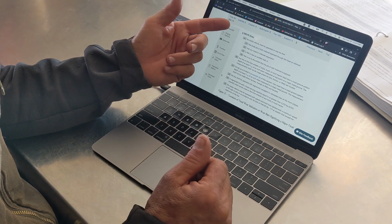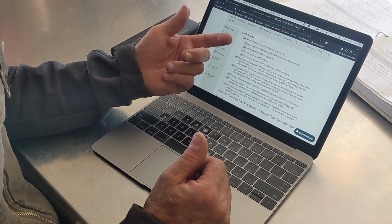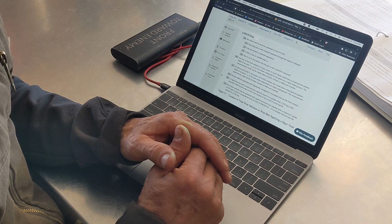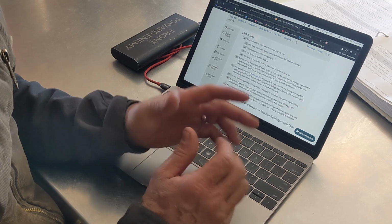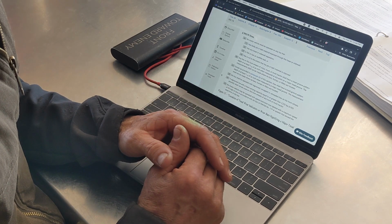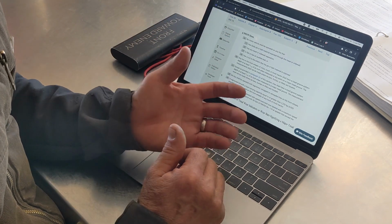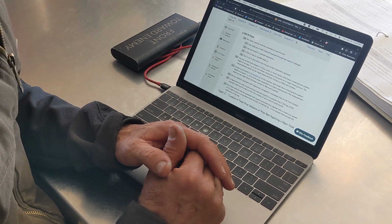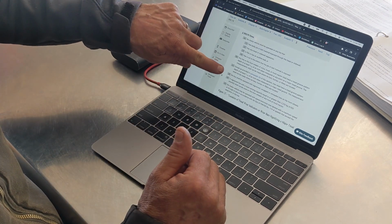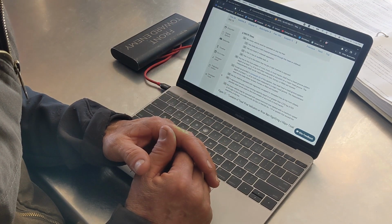Now, could a semi-truck use recapped or retreaded tires on the front? And if they were more likely to fail based on any evidence, you'd think that semi-trucks wouldn't be allowed to use retreads on the front. Well, they can. Again, it's common with operators to not put retreads on the front out of preference, but you can legally use recapped or retreaded tires on the front axle, the steer tires of a semi-truck. Even a semi-truck carrying hazardous materials can use retreads on the front. So the only legal prohibition is against using them on a bus that's carrying passengers, and you are no longer in that position if you're watching this video.